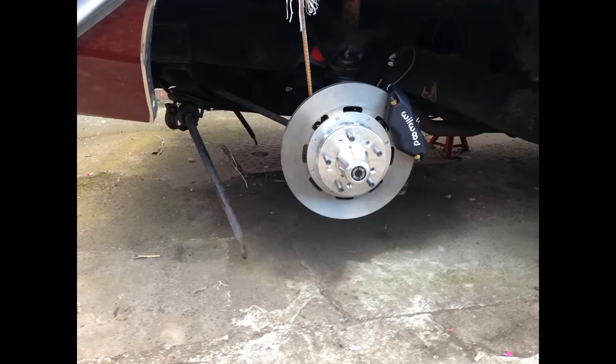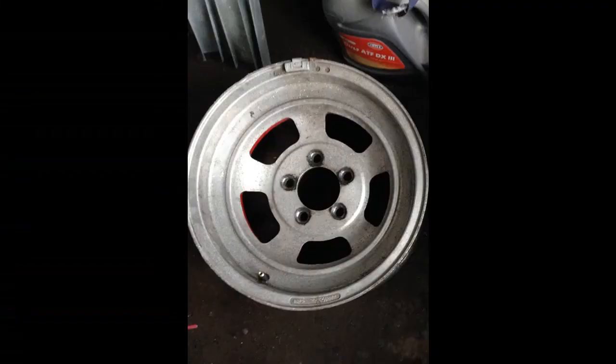When I ordered the kit from Summit Racing, there is a warning on the sales page saying that not all 15-inch wheels will fit the new disc and caliper, depending on the offset. And that's the problem that I had when I got the new kit fitted. This is my original wheel, a 15x7, which didn't fit — it was fouling on the new brake caliper.